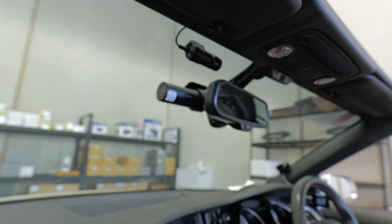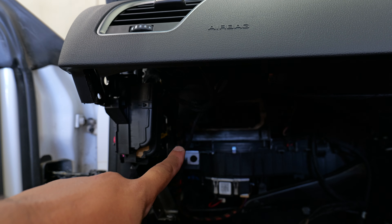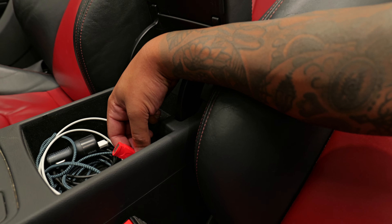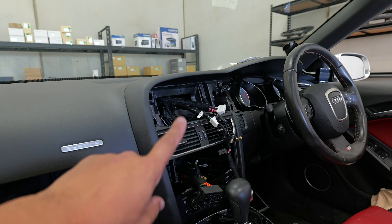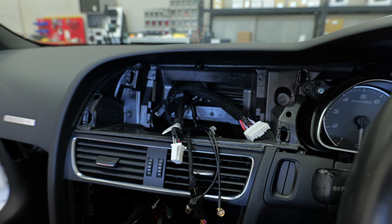With the roof down it's much easier. We've put the GPS antenna behind the dash here and run the microphone cable up — it's just hiding up there out of the way. To remove this panel there are screws underneath each side. We've taped all the wiring up inside. One USB goes into the glove box, the other into the center console. The remaining cables from earlier are still accessible, so we can move on to mounting the screen.